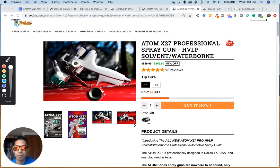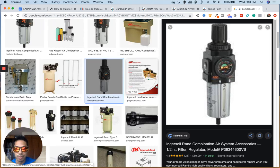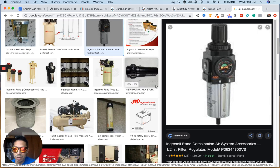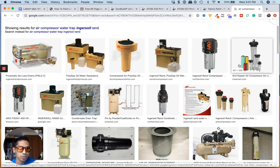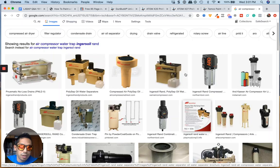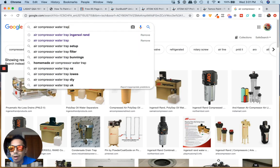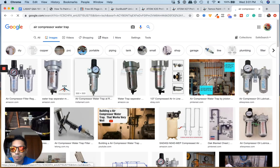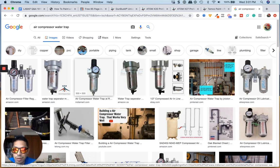So that's the system that I use. I've got an Ingersoll Rand — they also have an oiler, but you don't want to use an oiler or anything like that. There's a double system which is basically a filter and oiler combined, which you're not going to need. If we look at water traps, there's a bunch of different kinds that you can use. Here's a filter and lubricant — you don't need that. I would just look into one of these simpler filter units.